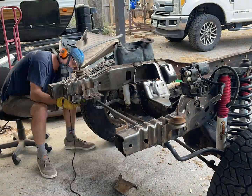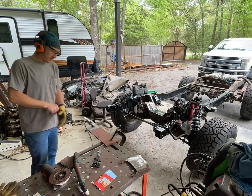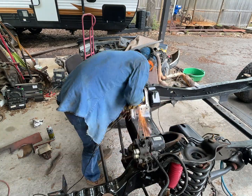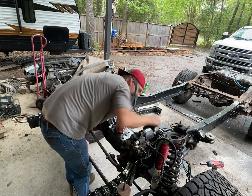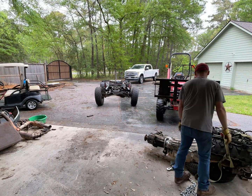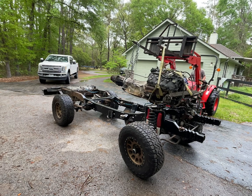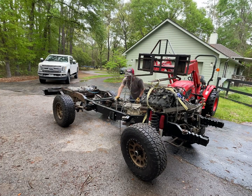At this point I'm just wire wheeling the frame — I had a sinus infection and really didn't feel like doing much else. Here in a second I'm going to start making some templates. There's that spot where I overcut on the AC compressor — I'm welding some metal back in there and adding a brace just behind there. What I'm welding in now goes on the other side of where the axle beam mounts, just to keep that from flexing since I cut out so much metal there. The last piece I'm cutting is another gusset on the driver's side to reinforce what I cut out as well. Can't have enough reinforcement. At this point I've got everything welded in that needs to be in. The frame has mostly been coated in POR15, and the motor is now ready to go in and sit in the frame permanently — which I'll find out here in a little while that it absolutely is coming right back out.